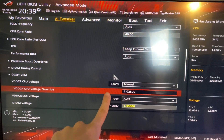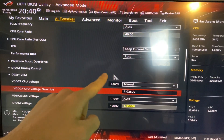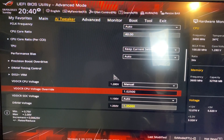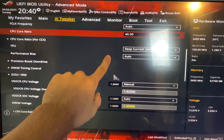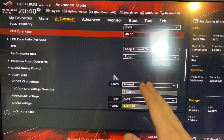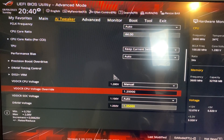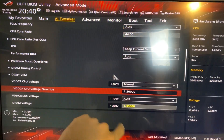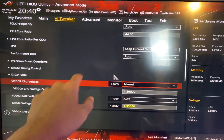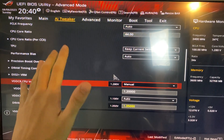If you want to learn how to tune this better: you can increase the voltage for more stability, because the lower the voltage, the lower the temperature and power consumption, but the higher it is, the higher the chance your CPU will be stable. You can also increase the core ratio to get more performance. For example, for maximum performance you might want to put 44 on the CPU core ratio and 1.2V on the CPU voltage override — this will give you about 10% more performance than putting 40. So you raise the two values and check if they work.